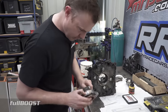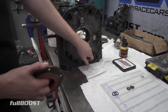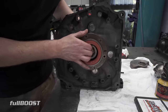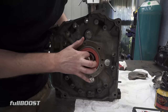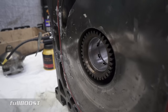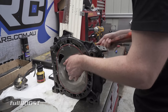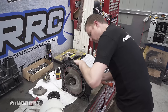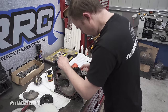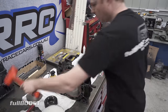This O-ring goes in here. On RX-8 engines it's actually in the back, but this is an FD RX-7 engine. All I'm going to do now is attempt to fit that. It's just a case of lightly tapping this into place with the rubber mallet. You don't want to put bolts in and drive it into place that way — that's definitely not the way to do it. Just give it some light taps with the rubber mallet to get it in place.